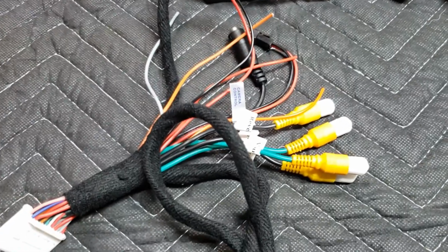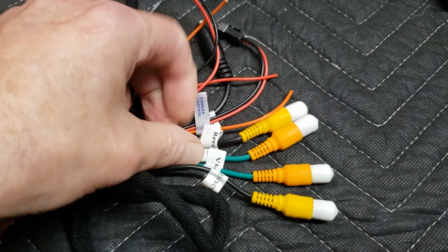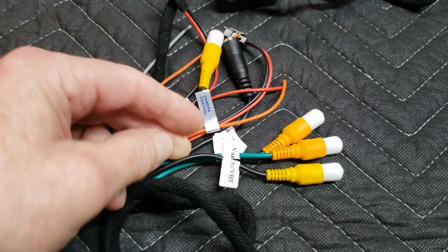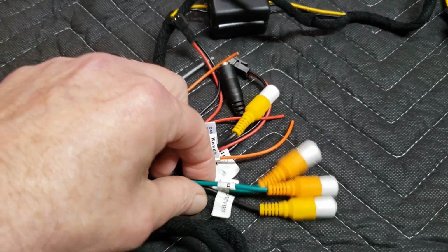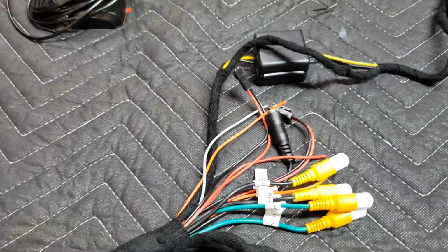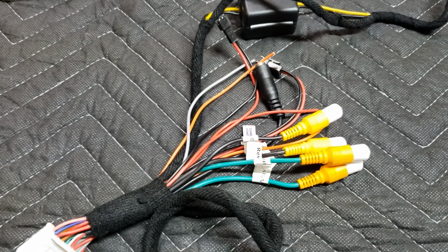As you can see, we have some RCA connectors down there. These are all in some shape for video, reverse camera. These unterminated ones, I'm not sure what these are. Camera control. This is something that we're going to have to look into as we go, because my F150 does have the 360 camera view, and the promise was that anything that you had with Sync 2 you wouldn't lose, because you're actually installing your Sync 2 unit onto the Tesla style display unit.